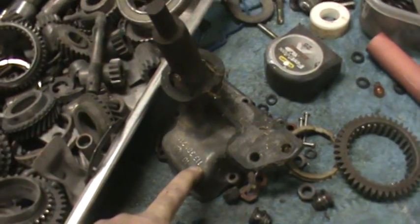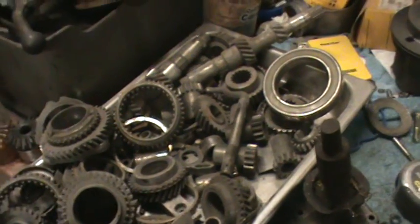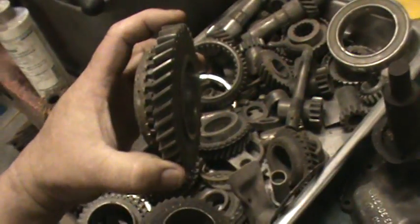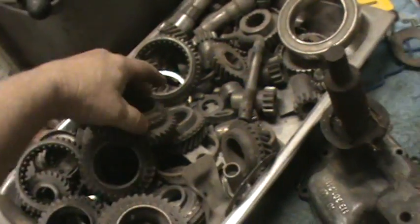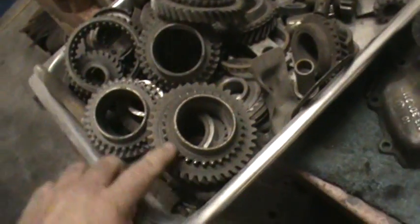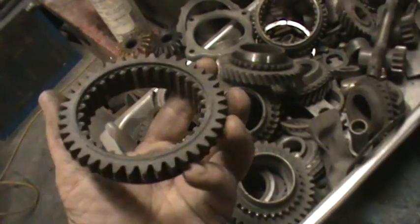Make sure your nose cone says 211 on it and is for a bus - 113 is a car, and nose cones for buses are very rare. If it's popping out of first gear, here are a couple of first gears - a wide one and a narrow first from a super early. This synchro has the synchronizer and synchro ring, and the ring is what holds the car in gear. This is a slider - it engages over that and locks the two together.